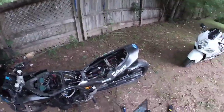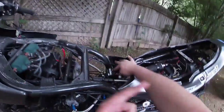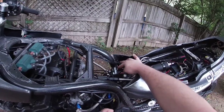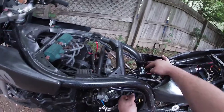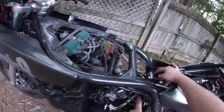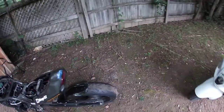Alright, so after that I removed the line going from the regulator to the fuel solenoid. Plugged this end just as a cap. It doesn't hold any pressure. It doesn't really hold anything but dirt out. This is a pressure cap. It's an AN6. Capping that off. I have gone through and changed pills in this one, and that one. And we're going to quick run through the last one, what I'm doing for pills.